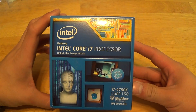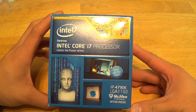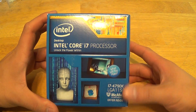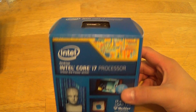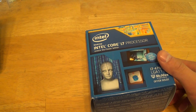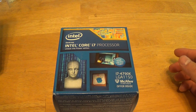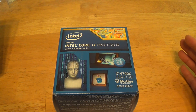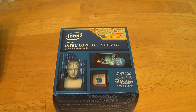This is one of their newest generation of processors. It uses the LGA 1150 socket. This particular model has an unlocked multiplier. Based on the Haswell manufacturing process, it's a 22nm chip. It has an operating frequency of 4GHz at normal operating conditions, and then it has a turbo max frequency of 4.4GHz.